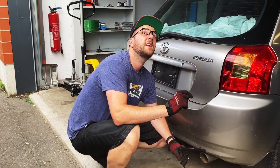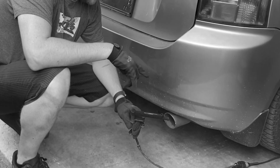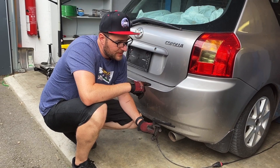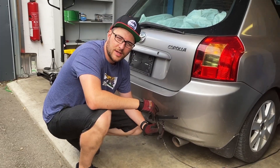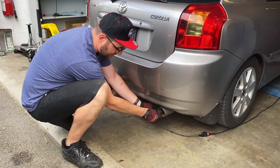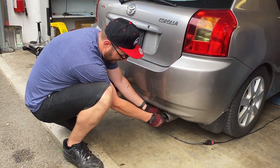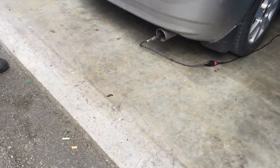When running a car on the dyno, always open the door or have exhaust ventilation — it's really dangerous and people have died suffocating from exhaust fumes, so never do it in a closed room without good ventilation. Since this is a stock car I'm also fitting an AFR sensor connected to my dyno into the exhaust, just to have an extra measure of security when running, especially since I may be using the engine later.